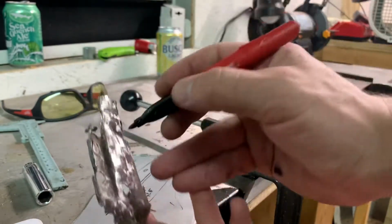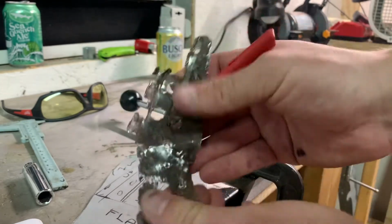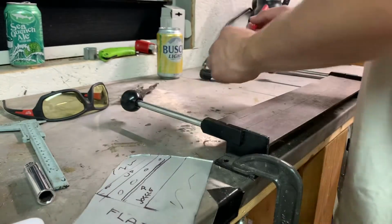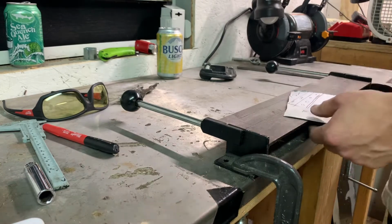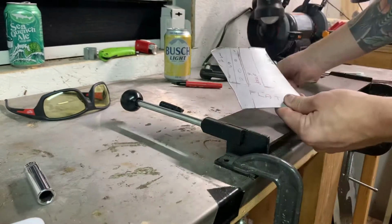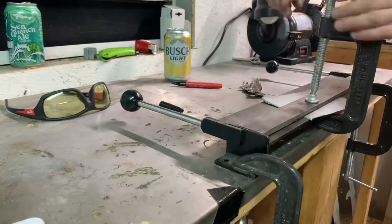So the area I'm pointing out here and emphasizing is a joggle. It's essentially a dip in the sheet metal, like a valley. Pretty difficult piece to make without a bead roller. Today I'm going to make this section by bending it up one way about 45, shifting it, flipping it, and bending it the other way. It is an effective way of making this section.